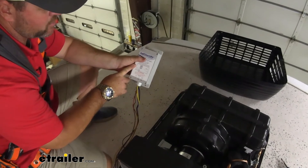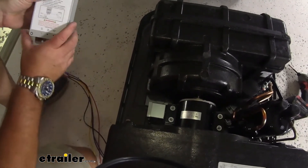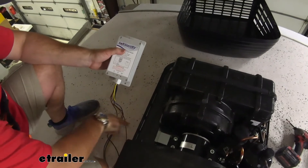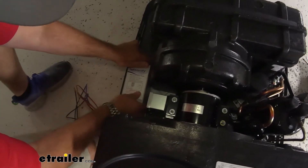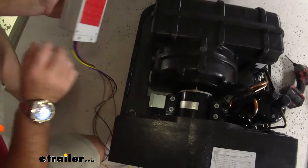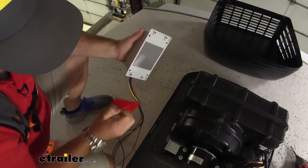Next, we need to mount the box. Make sure wherever you mount it, you can see the indicator lights. The only suitable spot on this unit is on the left side — we'll stick it right in there. We don't want it where the screw for the top goes, so center it between the screws so driving them in won't hit the box. Make sure the wires face back so we can run them underneath and over to the other side. On the back there's two-sided tape — pull it off and stick it in place so it doesn't slide around if we hit bumps.